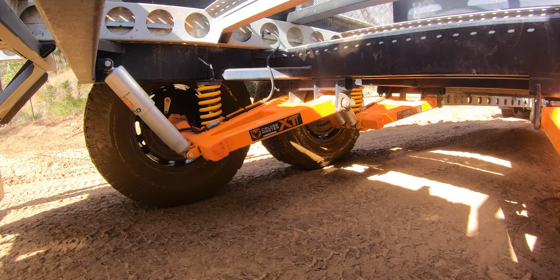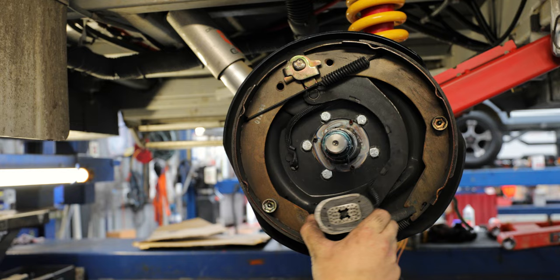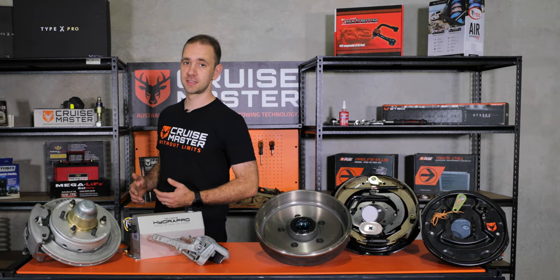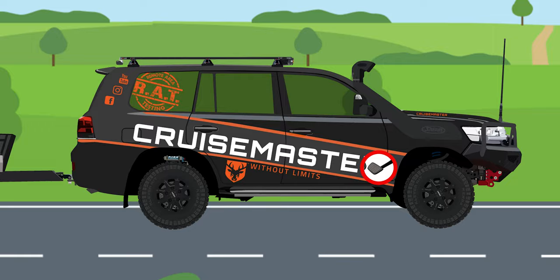You can also see there are a lot of moving parts inside an electric drum brake, which means they're not as durable on corrugations as their disc brake counterparts. Moving on to hydraulic disc brakes — these give the best performance of all the brakes on the trailer market. They work by having an electric-to-hydraulic actuator located on the trailer, which receives a proportionate voltage signal from the brake controller in the car and converts it into hydraulic pressure.